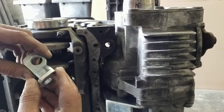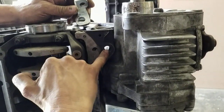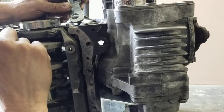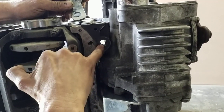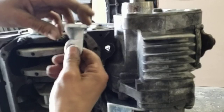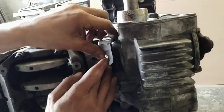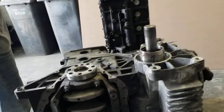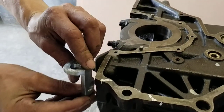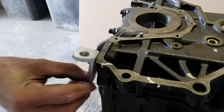At this point, that factory hole is a 14mm hole. What you want to do is drill it out to 14.5mm, then take a 16 by 1.5 tap and tap that all the way through — there's roughly 15mm of material behind there. That becomes the new mounting point for the block, since we've lost one mounting hole over here. This bracket becomes the replacement mounting hole, so the strength is back once this is done.